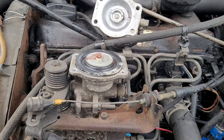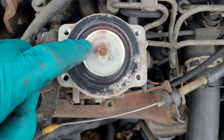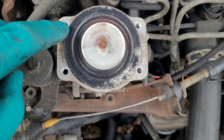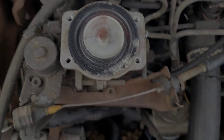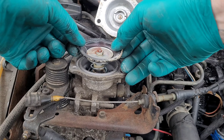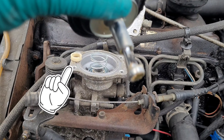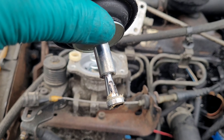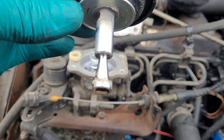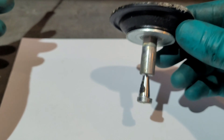Now this is what we need to look at and make our first adjustments with. Firstly, that little indent points to that thread, so just remember where that is. Then we're going to pull this out. Once this is out, don't lose that nylon washer or spacer. Now looking closer you can see the eccentric pin at the bottom and a little mark — or wear mark, or witness mark — where the pin rides. I'll explain the pin in a minute.